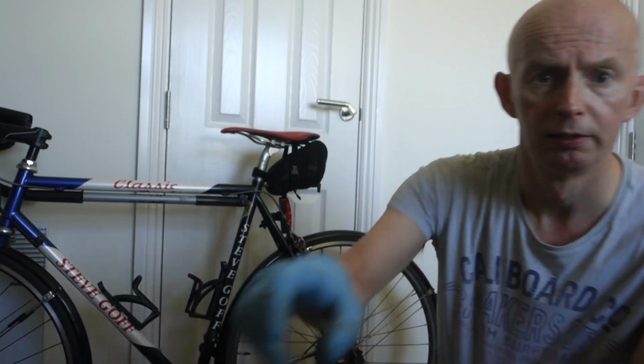Normally, on those other bikes, like the TCR and the turbo as well, I do the bottom bracket bearings a lot more frequently, so the cups are all greased and they come out easier. These ones haven't been out in 3 years since I put them in. Right, I'm just going to stop the camera, come back to you when I've done this.